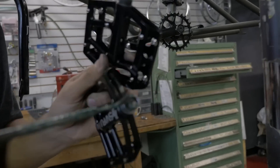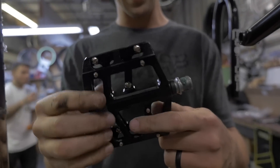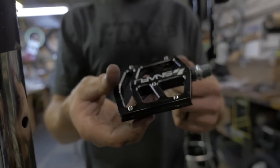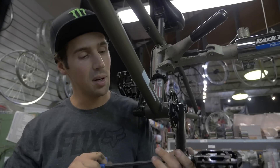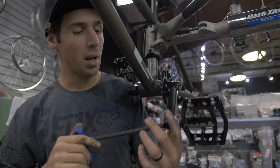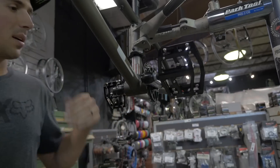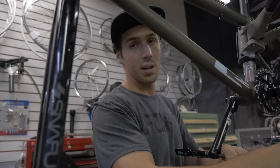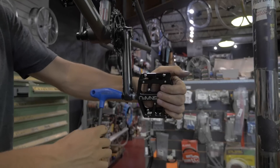Next up, we're going to put the pedals on. These are SNAFU Anorexic pedals, the newest version. Put some grease on them real quick. These pedals have a shorter spindle and shorter pins which come from the bottom up now — very easy to replace and they last a lot longer. These pedals are really light with the perfect amount of grip. Spin to the left to tighten the left pedal — the left crank is reverse thread, designed so that when you pedal the pedals actually tighten rather than loosen. For the right side, it tightens to the right because when you pedal forward on the right crank it's facing right. I've never had any issues with these pedals — really strong, really light, good amount of grip.